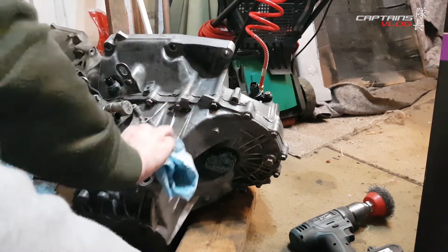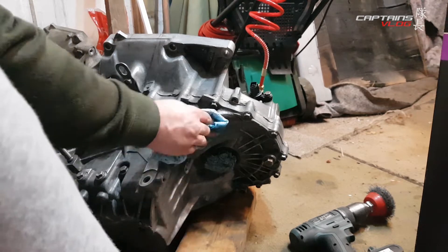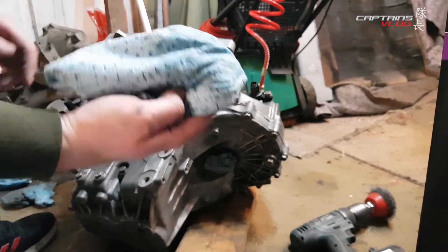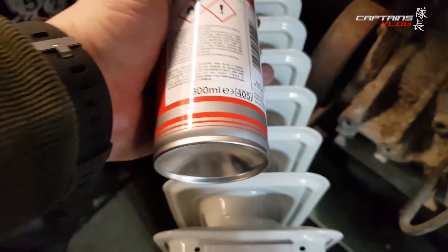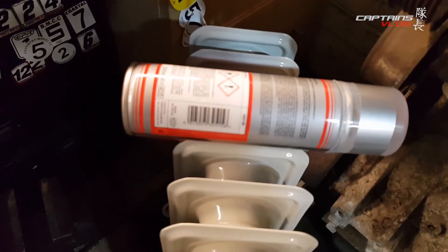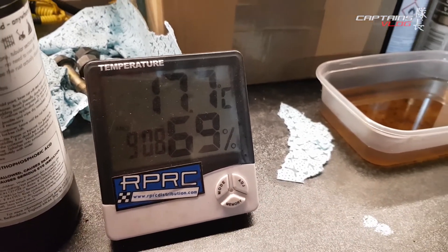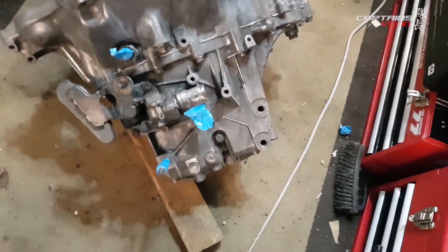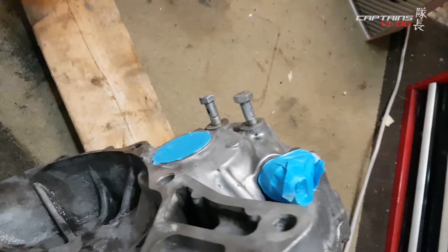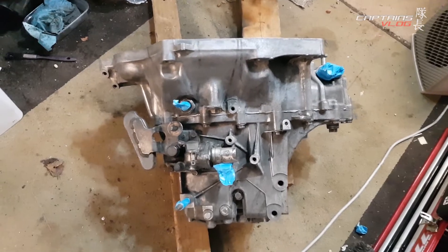Go over all the main big areas wiping and then hopefully she's good to go. Warming up the paint - we've gone for the very high quality Halfords own brand high temperature paint. It should work, it's only a gearbox. Temperature wise we're looking at 17.5 degrees, humidity levels are respectable. Got masking tape around the place covering all the switches, any threads on the outside, and the holes to the diff on each side so no spray paint can get inside.